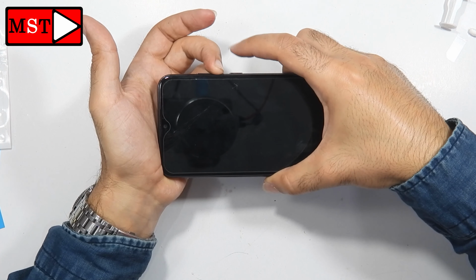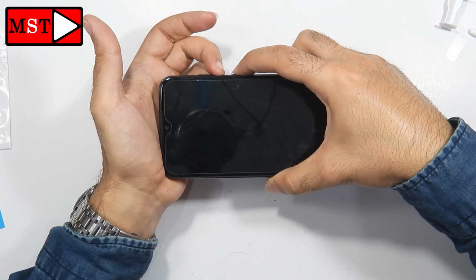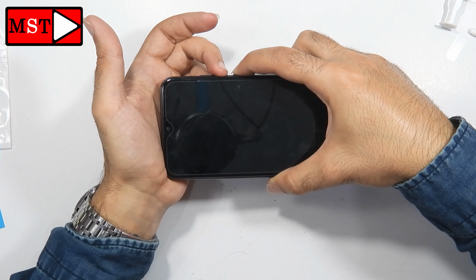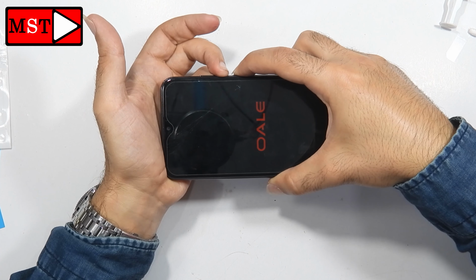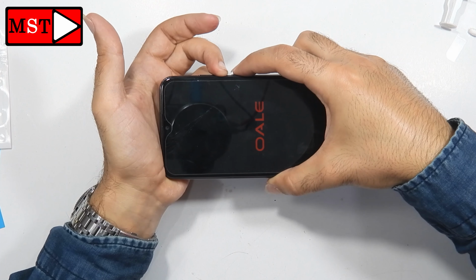Otherwise, the device won't access the hard reset mode. Again, the device is not functioning. You need to press the power, then you can hold the down button until we have a logo, and then keep pressing the two buttons until we hit the hard reset mode, and then you can release your finger.